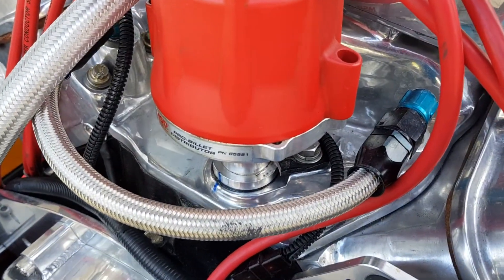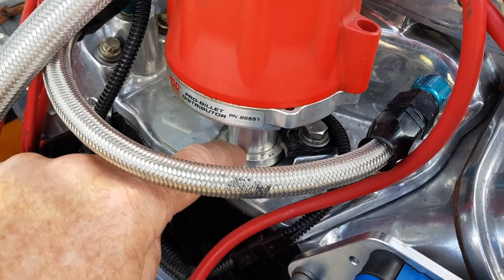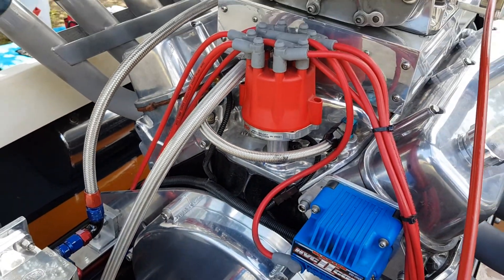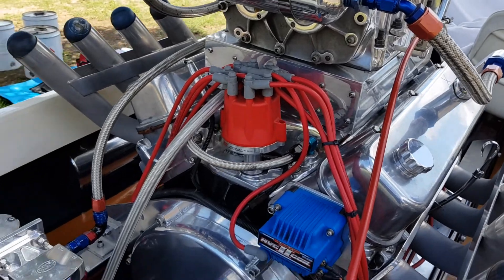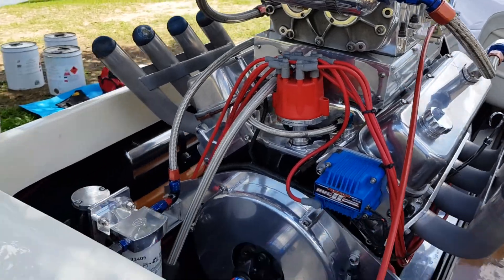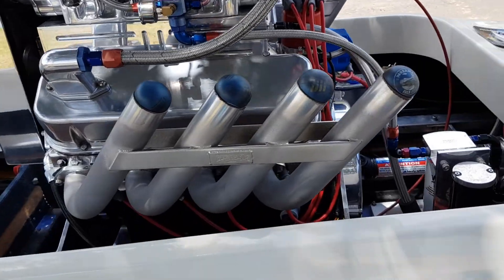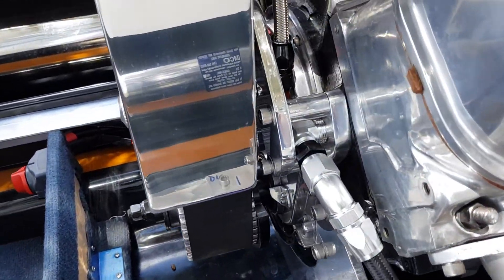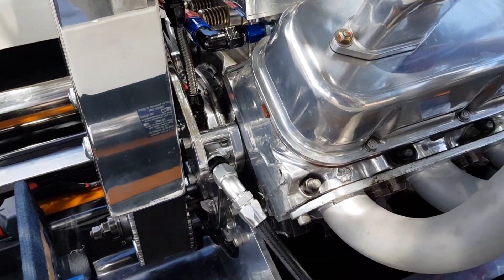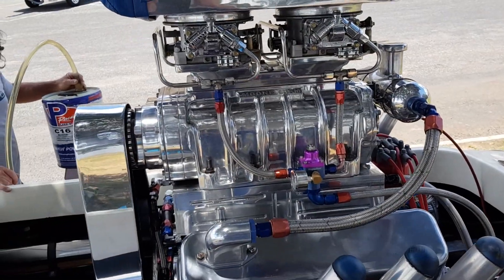We've run a bigger hose right through to the front. Another issue we had was a distributor clamp that broke — a little piece snapped off. I think it had a fold and a small crack in it. So we bought a new one and I'm about to fit that now. We'll also change the water fittings up here to run the slightly bigger hose right through from the back.